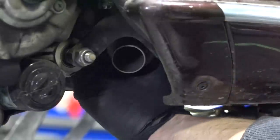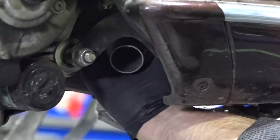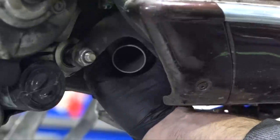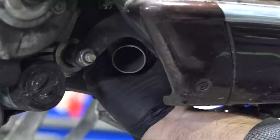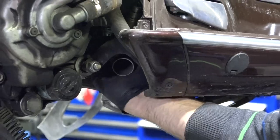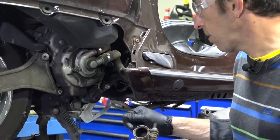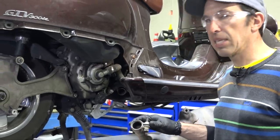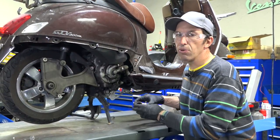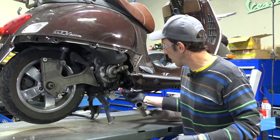The header is not broken — it's a stub header. The problem is there's only one of the two studs holding it to the cylinder head; the other stud is broken inside the cylinder head. This is quite an ordeal to fix. I'll do a whole separate video on that exhaust stud. Broken studs are typically found on scooters ridden hard on the freeway or with aftermarket exhaust, or if the muffler was incorrectly installed or not torqued correctly.